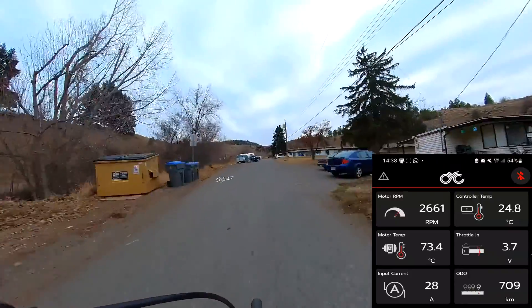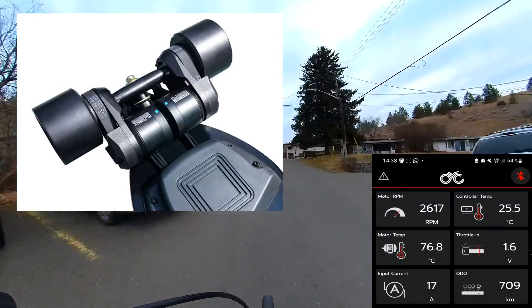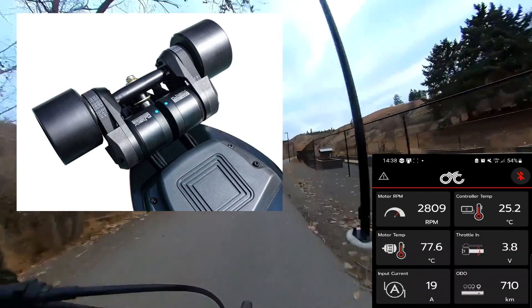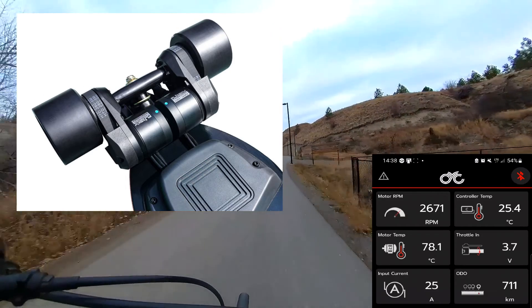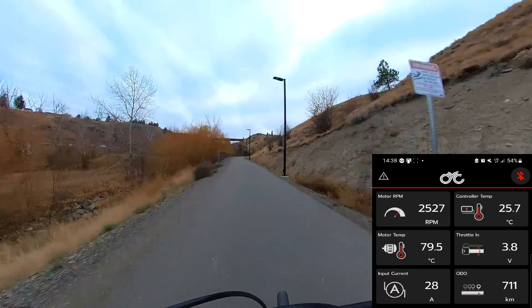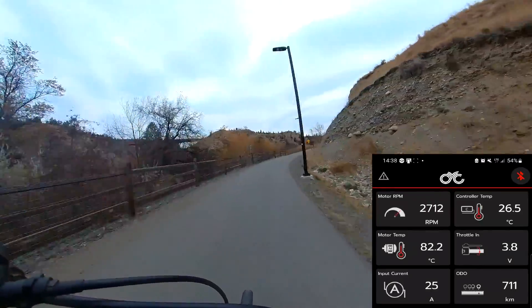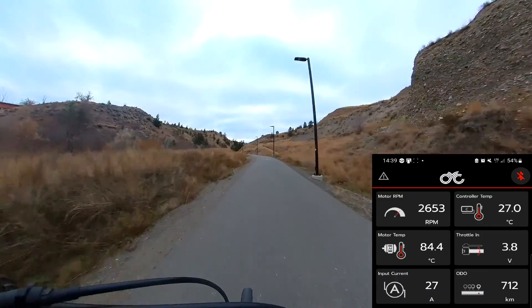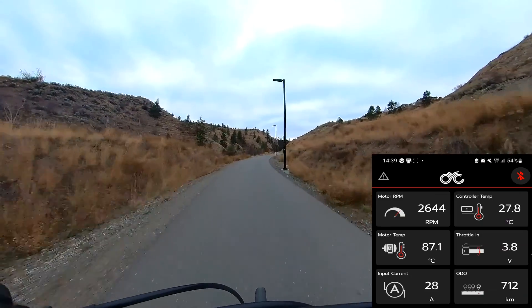What is not very common is the implementation that CYC have with the Photon and also with the Stealth motor. With a typical e-skateboard setup and pretty much every other outrunner setup I've seen, the motor casing is exposed to the air — or in the case of a hydrofoil, the water — so there's cooling airflow or water over the motor casing. With the Photon it's not like this. With the Photon the motor is encased with heat sinking, except it's not really acting like heat sinking should, because it's not in contact with the motor except in a very narrow area where the motor is bolted in position.